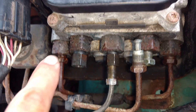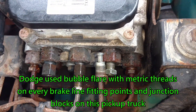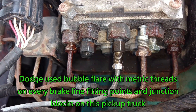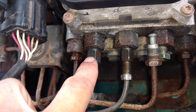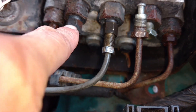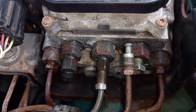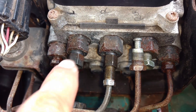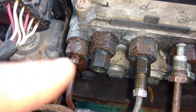That's why in this case, someone already changed the brake line and used a double flare. Because bubble flaring requires a special tool, they simply used a converter adapter that converts the bubble flare to the double flare. Now you can use the double flare here. But if you want to directly fit into this port, you need to do bubble flaring. Otherwise you have to use this converter.